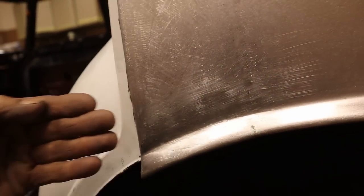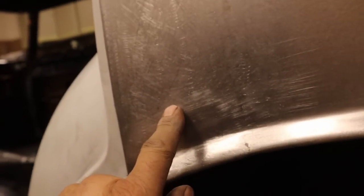What's going on here? So we're starting to get pretty close along here. I'm banging all my way up this fold here, tightening it up. See if you can see the difference. I don't know if you can tell. It's nice and square looking there. Still looks a little round bit here. So just going down, tapping this corner back, tightening that radius up. And it also has the bonus that it pushes this edge out. Then this isn't the high spot. That gets rid of our pillowiness.